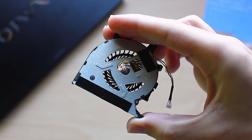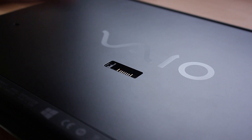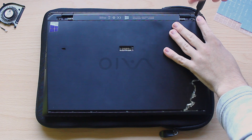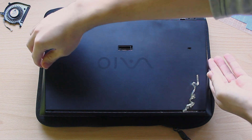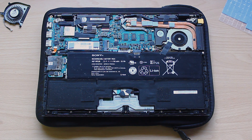This will also give us an opportunity to see how good of a job I did applying that thermal paste. We're starting by opening the laptop — depending on your laptop this might be easier or harder; follow a guide online, I recommend iFixit, and take it slow. Since my last video I added thermal pads between the cooler and the laptop's chassis. This allows the CPU to transfer heat through the chassis, and it does work — I noticed a significant delay in the fan ramping up after I did this.